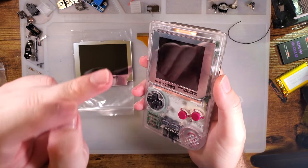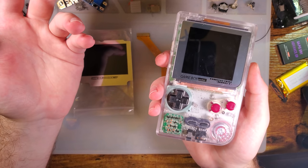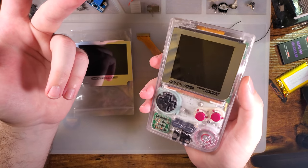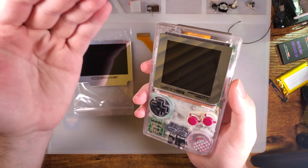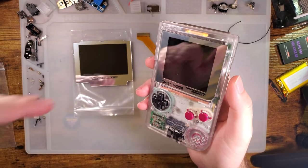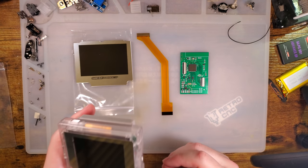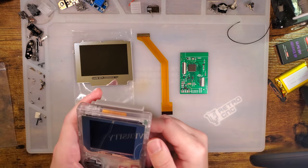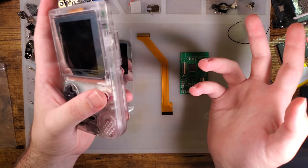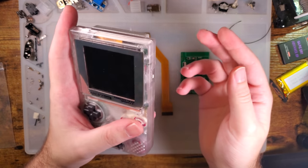That's also the same reason they went with plastic lenses instead of glass. It's more durable than glass. You drop your plastic lens, it might scratch, but it's not going to shatter. And most of all, because of price. Lamination is one extra step, costs money. Glass is also more expensive than plastic. But it's not without its trade-offs. It is cheaper, yes, but it is also more durable, and I think that is the key factor in the long run. I did actually do a full write-up on lamination in my Backlight wiki that I will have linked in the description, but this is basically the TLDR of that.